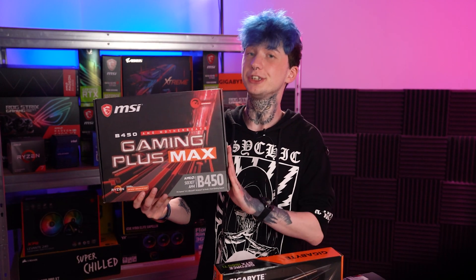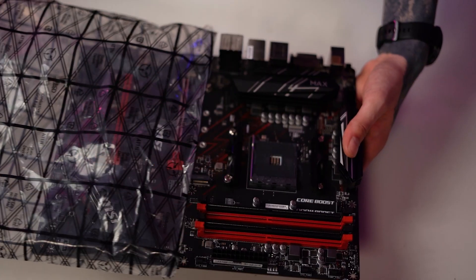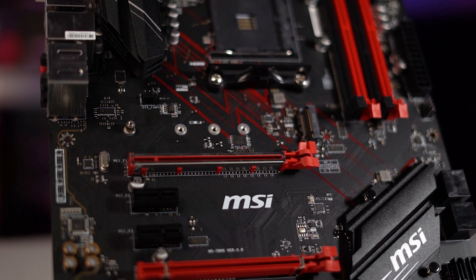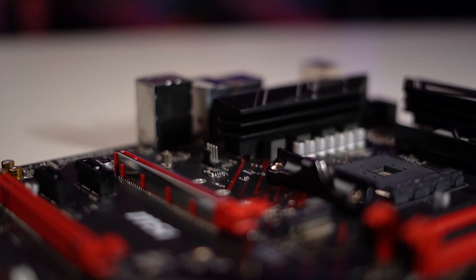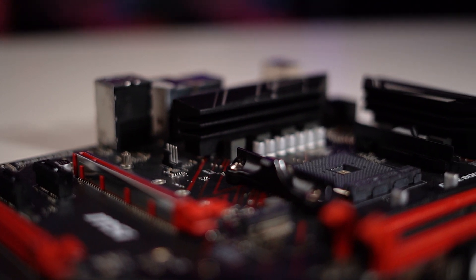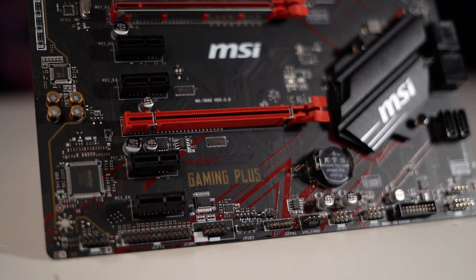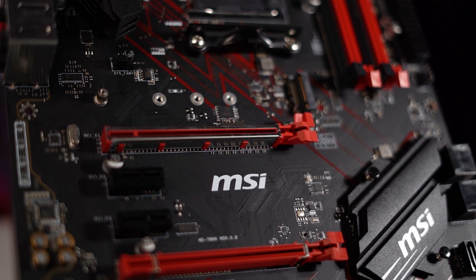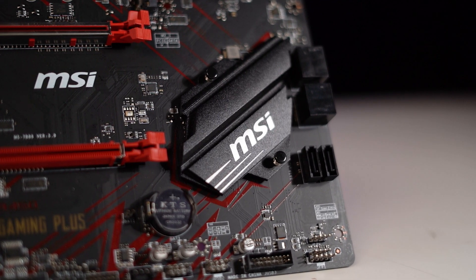From the ground up, I chose the B450 MSI Gaming Plus Max as our motherboard. This ATX board can support up to third gen Ryzen processors and second gen Ryzen APUs out of the box, but a BIOS update will extend that compatibility. It supports PCIe Gen 3 — not the latest generation, but our GPU of choice can't take advantage of Gen 4 anyway. There's a whole host of useful ports and technology crammed into this board including USB 3.2 Gen 2, 32 gigabit per second turbo M.2 technology, core boost technology, audio boost technology, and everything else you'd expect to find in a motherboard these days.